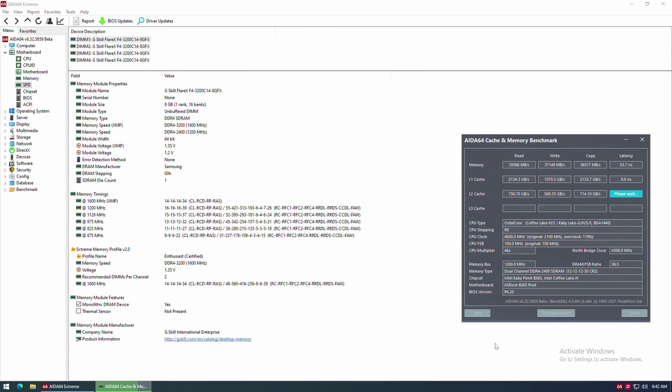After solving the overheating problem and applying a decent overclock, I decided to try overclocking the memory — and here I got another disappointment. Like any other mutant CPU I've tested, the QTJ1 also has a weak memory controller. The CPU refuses to start with anything higher than DDR4-2400; even DDR4-2500 simply won't boot. All tests were therefore conducted using DDR4-2400 CL12, as I was at least able to tighten the timings to CL12.